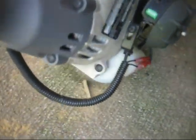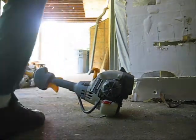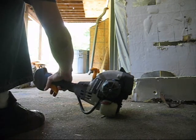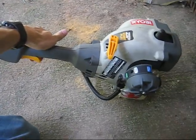Alright, well, here it is — I got it all working perfect. The carburetor was just a little out of adjustment. And it's one of those new ones, you know, it has the little screws that you can't possibly adjust. So what I did was I slotted them with the Dremel — with the cutoff wheel on the Dremel. So now I can adjust them with a flat screwdriver. So now it runs perfect. Here we go — let's start it up. It all works perfect.